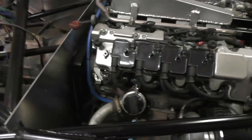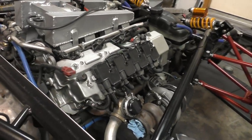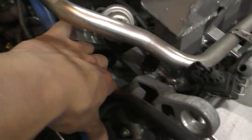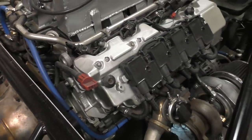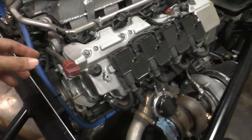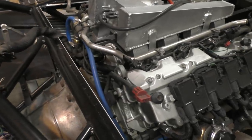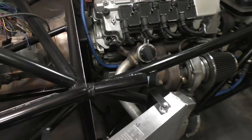There's a small improvement I'm planning for this system based on something Tasos pointed out — he rebuilds AMG engines and has a great channel I'll link below. He suggested I open up the plug on the other head so coolant can flow through both heads, which should improve coolant flow and keep both heads at the same temperature. So I'm planning to open that plug, cut this line, and connect it so coolant from each head goes to its own turbo. I didn't do it now because it's a hassle to access, so I'll wait until the next engine-out.